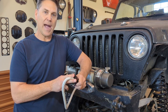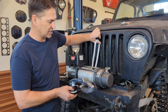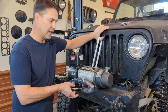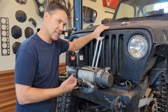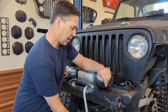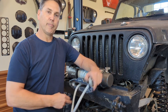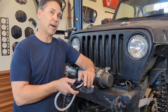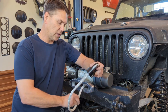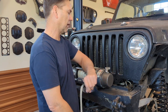The reason they call it the safety thimble is it's got a big fat back right here. So when you winch this thing in, it will pull in and suck up to your fair lead without pulling through — so if somebody's not paying attention, it's not going to suck your hand in there and get you hurt. No pins to remove; all you do is run that line around, bury it, and it's good to go. If you break your winch line on the trail you can cut it and splice it right back in using the same thimble.